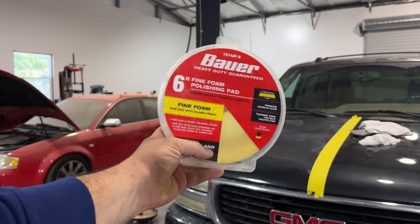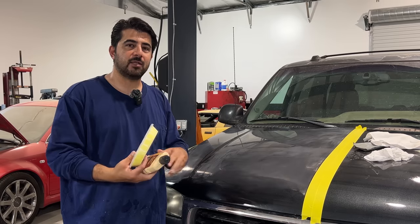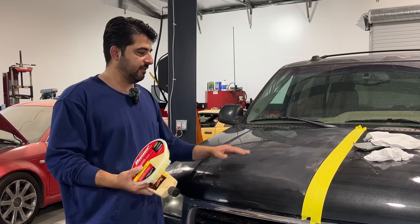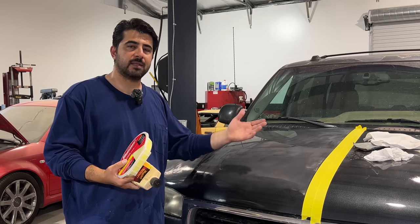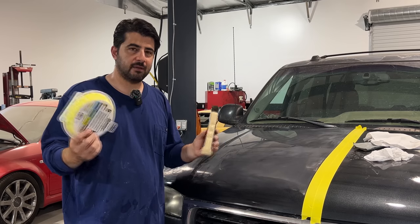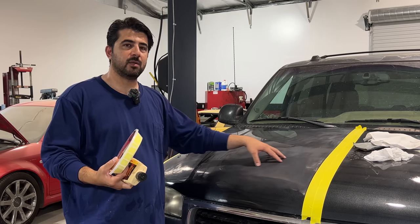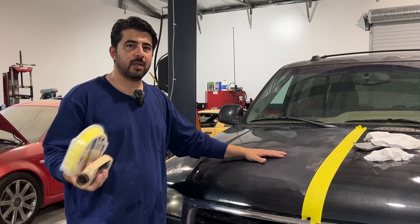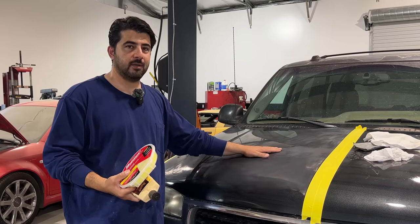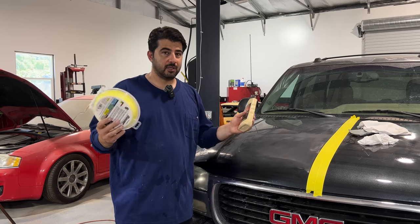After compounding, you want to polish using a foam polishing pad and the polishing compound of your choice — that gets rid of the swirl marks and minor scratches left by the coarse foam pad or wool pad. After that comes the final step using a finishing foam pad and finishing product. We're not going to use that third step here because this clear coat is newly sprayed — you need to wait about four to six weeks or longer for the clear coat to cure properly before you put any sealer or wax on it. Also note that some people use 'polishing' and 'finishing' interchangeably.